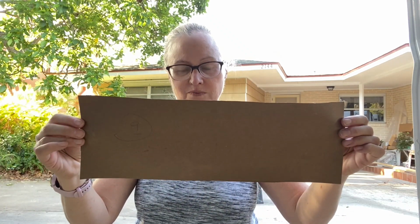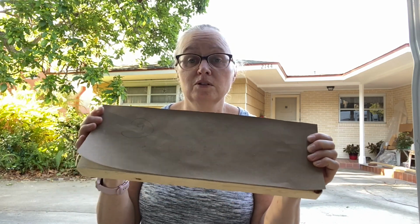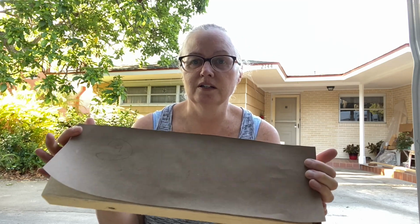And then last night, while Andy was finishing up the holes, I made a template for each one, just out of the carpentry paper that I've been using, construction paper, I don't know what you call this. Anyway, I've made this so that it fits the board, just so. And then what I can do is tape this up and punch holes through where the holes need to be for the plus nuts, and then I can transfer those markings to the board, pre-drill them, and then put these up with the bolts. So it should be pretty easy to go up once I have all the holes drilled. So I'm going to work on that next.